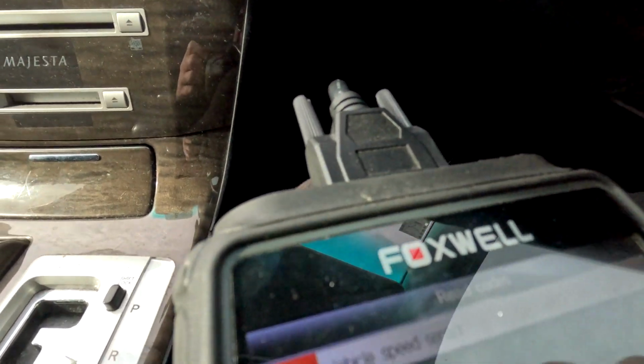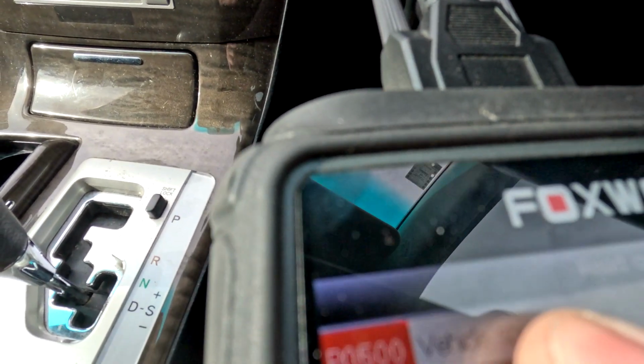So I had those 4 lines of data: engine speed, vehicle speed, NO and NT. And we just dropped that vehicle speed. Kind of points to where the problem may be. And it's going to be a P0500.